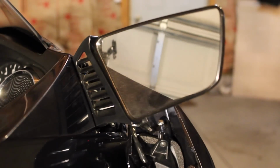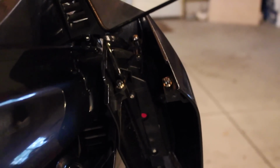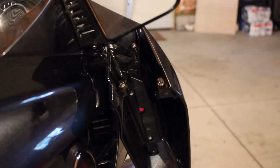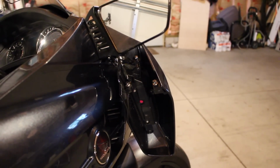And if you see it down there, now it's just hanging. Make sure that you do that gently, so you don't end up scratching anything on your bike. But as you can see, that whole unit just slides out. So now I'm going to move you to the other side, and we'll take a look at what you've got to do on the actual bolts for the front cover.